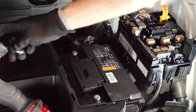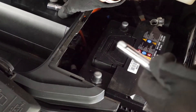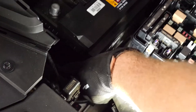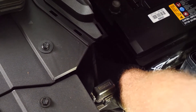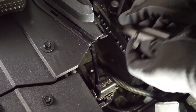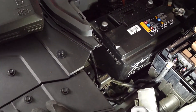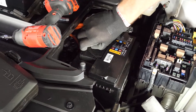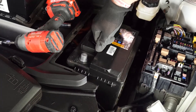There's one more bolt to loosen — that's why I have all these extenders on the tool — to reach down to the 12-millimeter bolt that holds the battery bracket down. Loosen that and take the bracket out. Now the battery is loose. Shift it forward about half an inch and then lift it straight out.